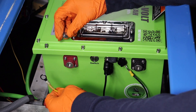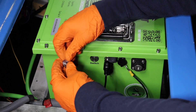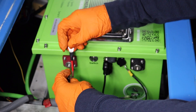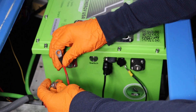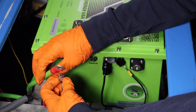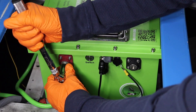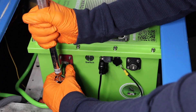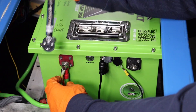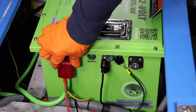Starting with the positive side, go smallest to biggest with the biggest touching the terminal. The smallest item is the yellow wire from the 12-volt reducer. Next is the red wire from the charger pigtails. The final wire is the new main positive cable. Secure to the positive post and, using a torque wrench, tighten to 11 foot-pounds or 132 inch-pounds. Then put the positive terminal cover in place.